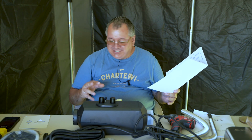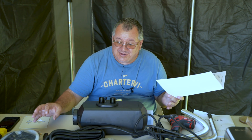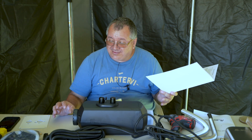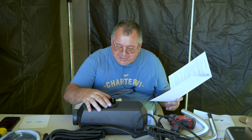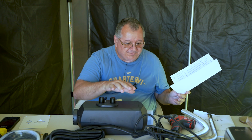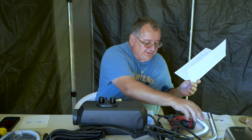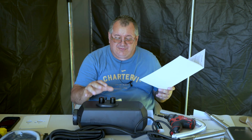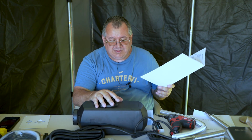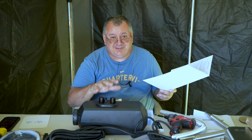Then there is a flange that is using heat-proof silicone, which is supplied with the accessory installation kit. So that is done, that is in place. We are now ready to install some of the wiring harness, fuel line, air intake, exhaust. We actually install that on the diesel heater before the diesel heater is mounted into your RV, camper, trailer, caravan. Again, whatever you're installing this in.